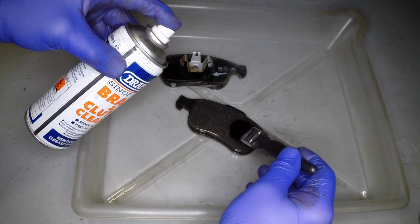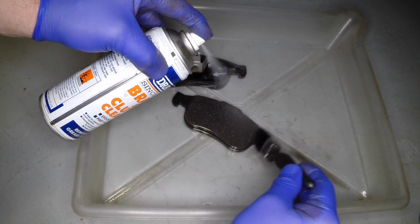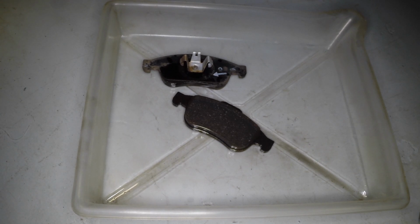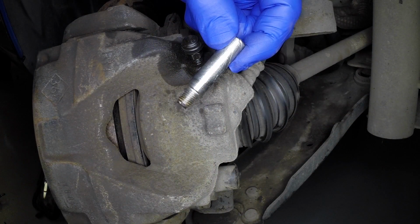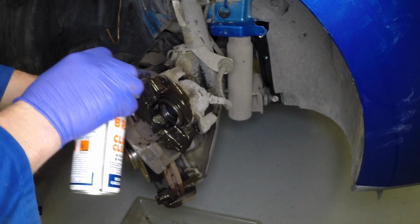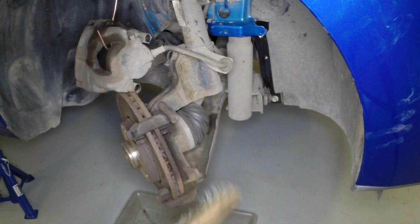If the brake pads are still serviceable, carefully clean them using a clean, fine wire brush or similar, paying particular attention to the sides and back of the metal backing. Carefully clean the pad locations in the caliper body / mounting bracket. Prior to fitting the pads, check that the guide sleeves are free to slide easily in the caliper body. Brush the dust and dirt from the caliper and piston, but do not inhale it as it is a health hazard.